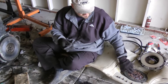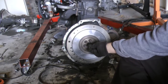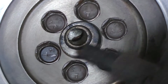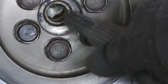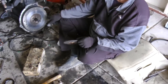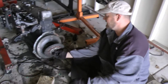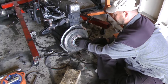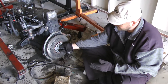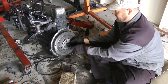First, get the clutch alignment tool — it lines everything up. There's the pilot bushing right here, past the flywheel, actually in the crankshaft itself. It's a brass or bronze bushing that keeps true alignment of the clutch. Stick the tool through the clutch first, then into the pilot bushing, and see how the clutch sits right where you want it. This is the exact position you need before putting the pressure plate on, so it lines up with the pilot shaft on your transmission.